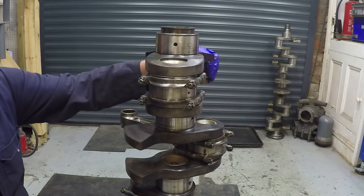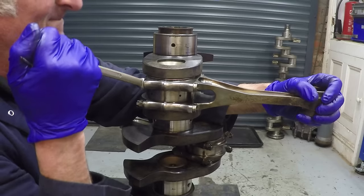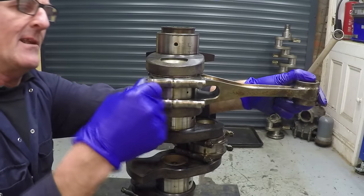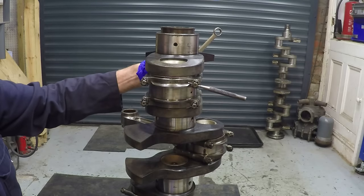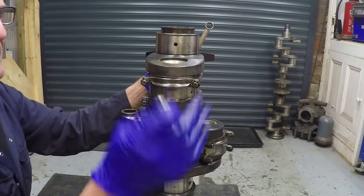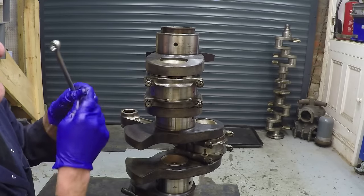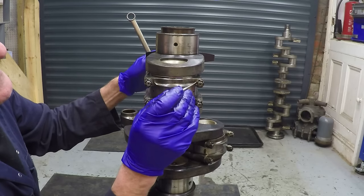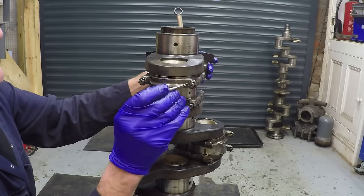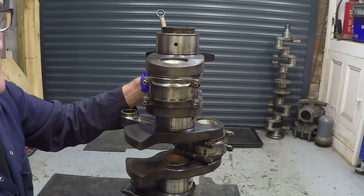I can't see that one at all. What they did was start to introduce ground split pins, which you'll see will fit - and they're just a very close tolerance. You can see the twist on that one - they're all about the same. They're a very close tolerance fit through here, so they don't vibrate, they don't fatigue, and they don't fall out. Following on from that, when you fold the split pin over, you do have to be a little careful not to ram it down against that sharp corner, or up over the top, because that can cause them to fail as well.